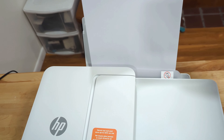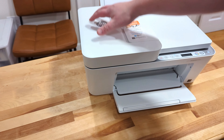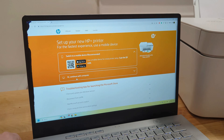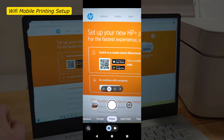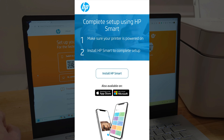We'll go ahead and slide some paper into the printer so it's ready to use — it's just going to slide right into the top. And we've got to connect this up to Wi-Fi to be able to wirelessly print. Wirelessly printing is going to be super simple. Just go onto your computer to 123.hp.com, and this will bring you directly to the screen to either set it up on your mobile phone or your computer. Because HP says it's recommended to do this from a mobile device, go ahead and open your camera screen, go to 123.hp.com, then install HP Smart.